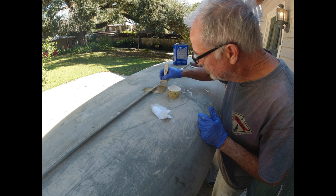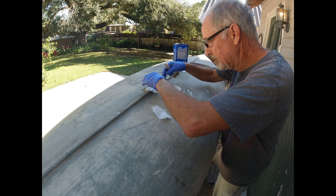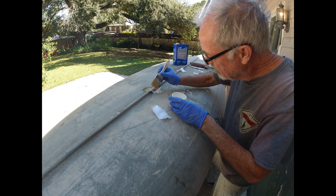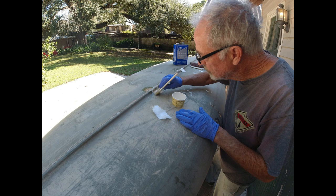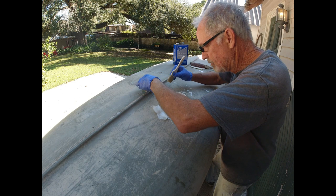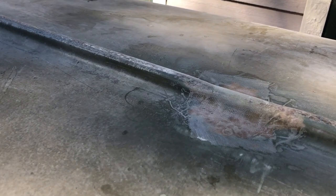This is my first patch on this little boat. Everything is epoxy — no polyester resin — and lots of layers of fine, lightweight cloth because of all the little bends and angles. The boat is incredibly thin. I can't put a whole lot of glass on there or I'll have a big lump. I've ground down the area, ground down to my thickened epoxy on the inside that's holding the plastic pipe, and around the circumference I've ground as much as I was comfortable. Structurally, my two little keel patches on the outside are done. They'll need fairing but I'll save that for later.